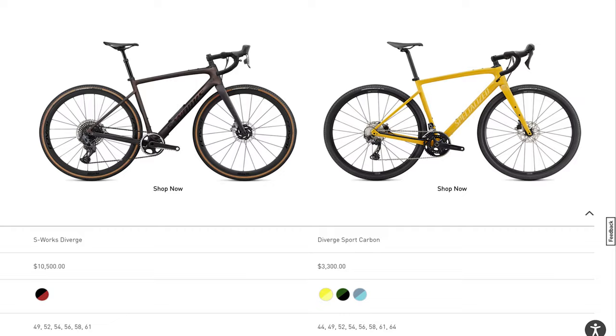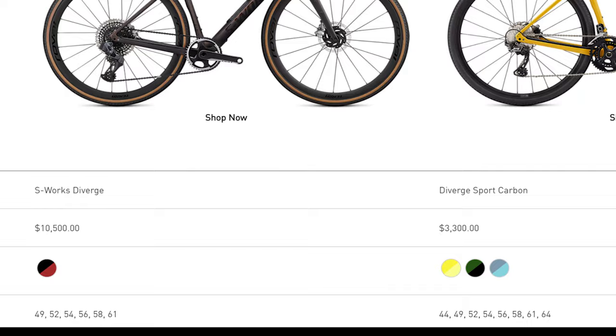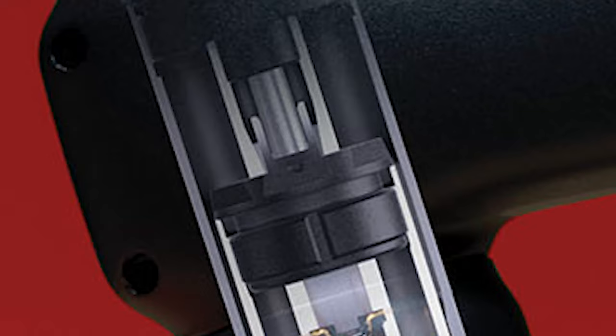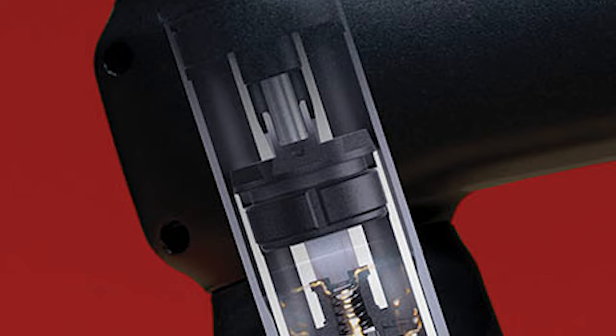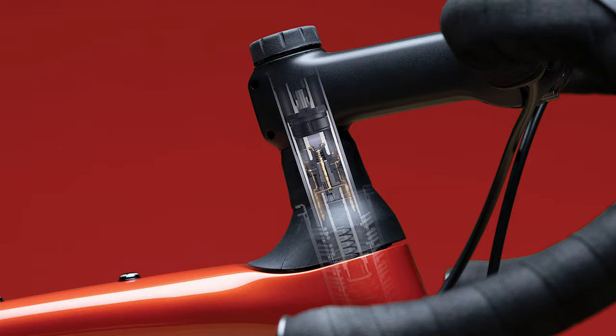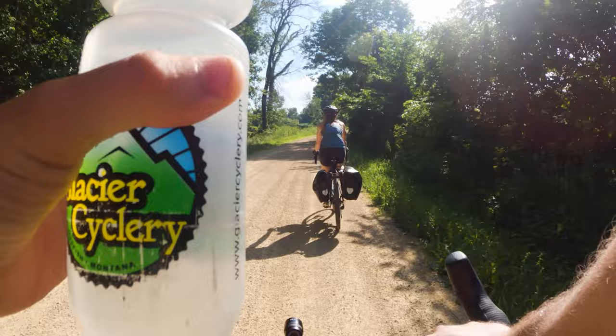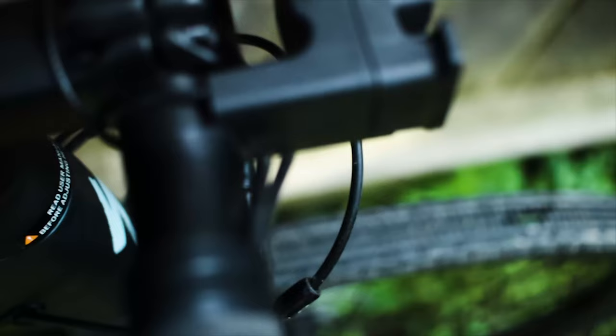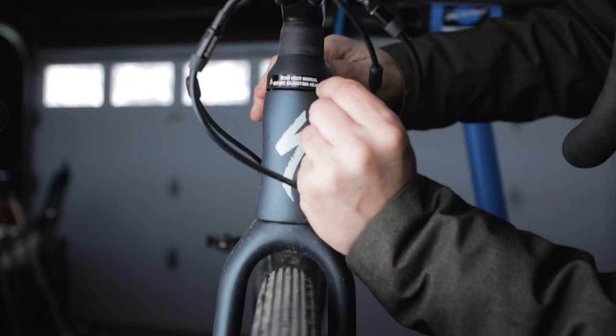This can be an important decision because there are significant price jumps on bikes with the 2.0. Removing cost as a factor, the on-the-fly adjustability of the 2.0 is nice, but this truthfully comes down to convenience. Your decision between the 1.5 and the 2.0 should come down to the benefits of hydraulic damping — if your rides are predominantly on rough terrain with lots of road chatter, the damping of the 2.0 will work better for you. But on a typical road ride, the 1.5 is more than adequate.